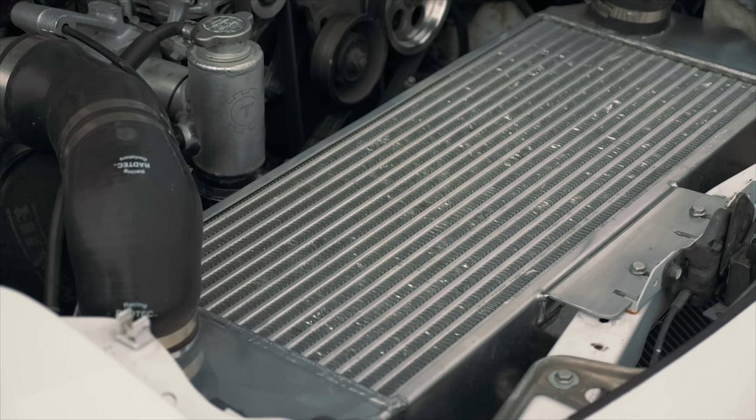How do you build the engines? They're totally different from piston engines. There's only three moving parts: two rotors and one shaft going through the middle. So when you build it, you basically increase all the port sizes, just like your inlet manifold on a piston engine, you do a massive port in to allow more air and more fuel in.